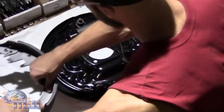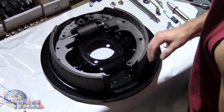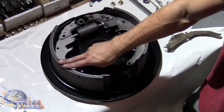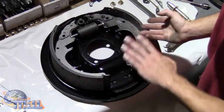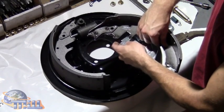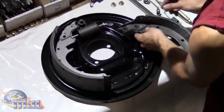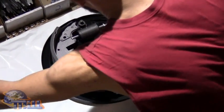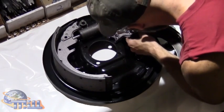Next, we bring in the shoes, and since this is a right plate, there's a way the shoes go. There's a thicker shoe and a thinner shoe, and the thicker shoe goes on the rear of where it's going to go on the vehicle. So there is a difference to which way the shoes go on. We take the emergency brake arm, slide that through the forward shoe, and take an E-clip and clip this into place. Again, this pin hole is greased, and there is a bowed washer placed on it to keep it secured in position.